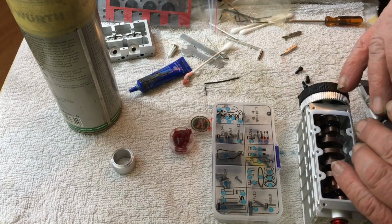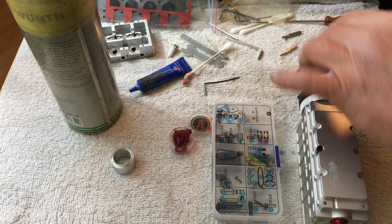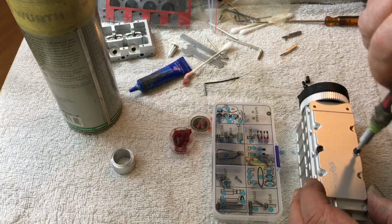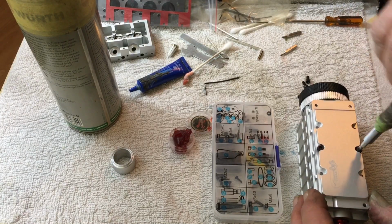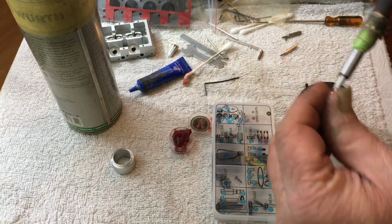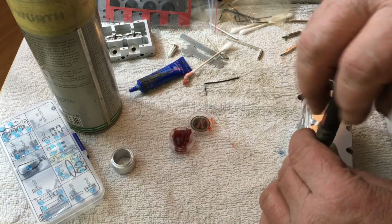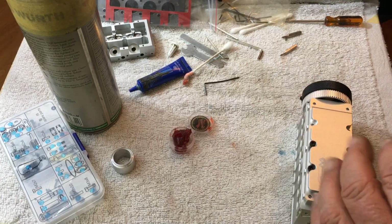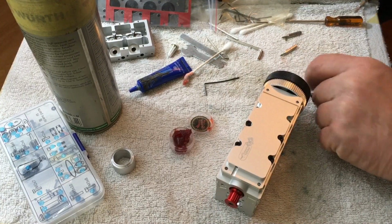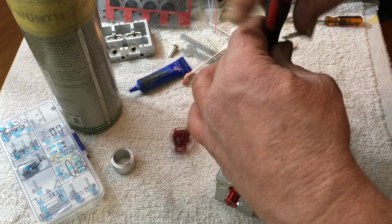Okay. They say to start with the center holes. Just get them started. I didn't Loctite my pan bolts because of the simple fact that I kind of wanted it serviceable, and so far on my other one I have not had them come out yet. So you don't want to over tighten the gasket, the Teflon gasket in there. You just want to evenly tighten everything.